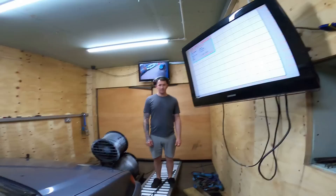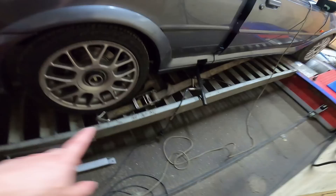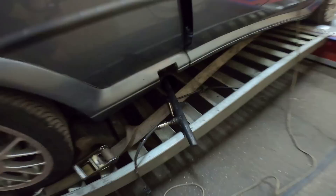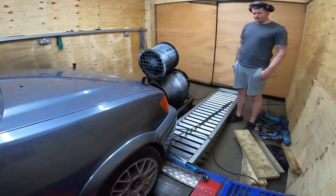We're in the cell now. Jamie's got his ear defenders on - two pairs of ear defenders. It's all strapped down, back straps on, wheel chocked, handbrake on, lambda probe in his lovely side-exit exhaust. Side straps on too - he's got a nice metal brace across the front of the car so I've put my ratchet straps onto that to stop it going side to side. Cooling fan on, not much left to do other than run it up.